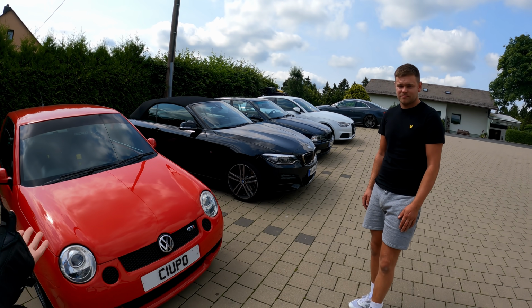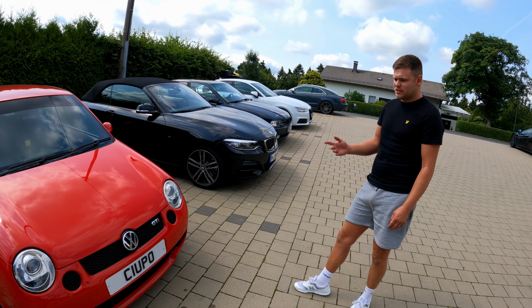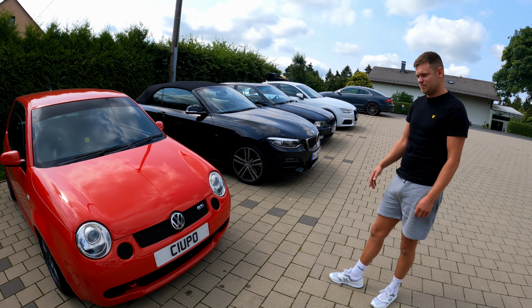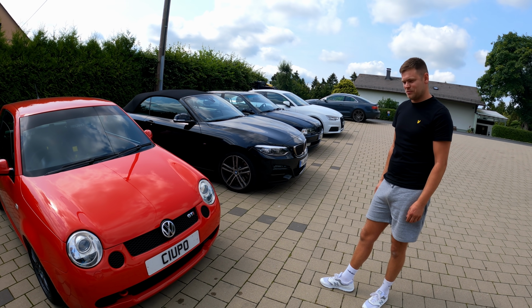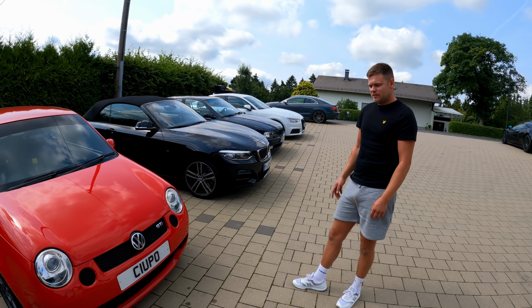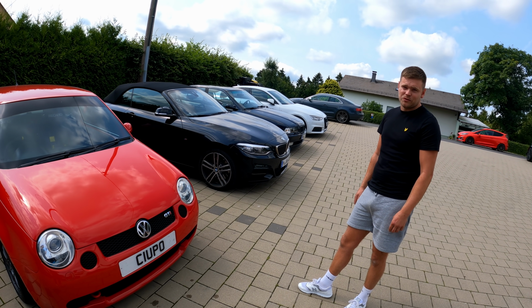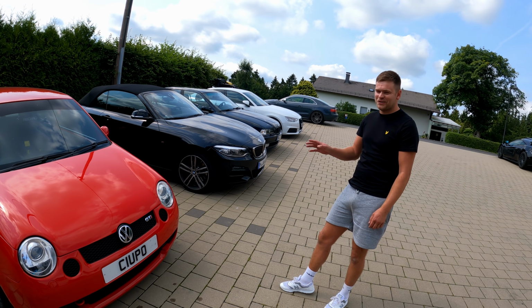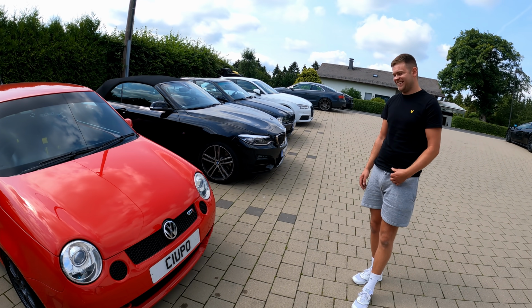So first of all, it's slightly modified underneath the bonnet. It's still the standard 1.6 16 valve, but it had headwork done: port and polished, cams, manifold, decat and that sort of stuff. Stock it's running 127 horsepower, and the last dyno it went on made 169 horsepower. 169.9, I heard. 0.9, yes, that's very important. Almost 170.